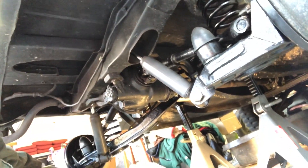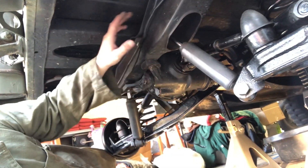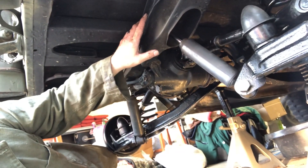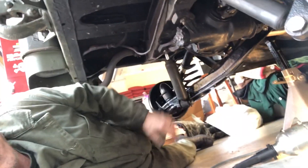I've been on my back for a better part of the day. It's been a high of 41 or something like that. You can see here, suspension's back in. This shock is completely bad — it's got a bad bushing up here, so we're going to have to replace the shocks. We'll replace them as a set and we'll get them from Frontline Military Vehicles.